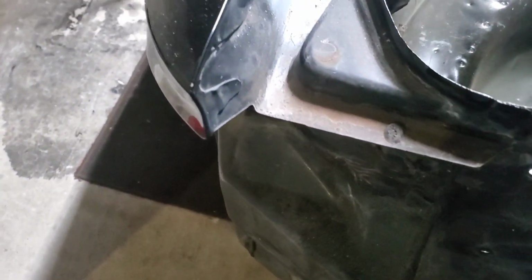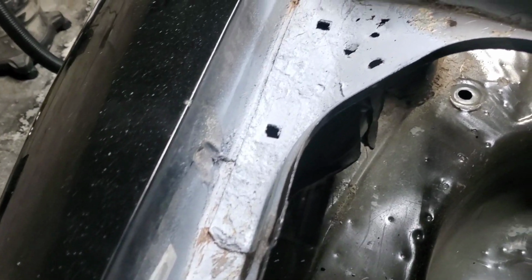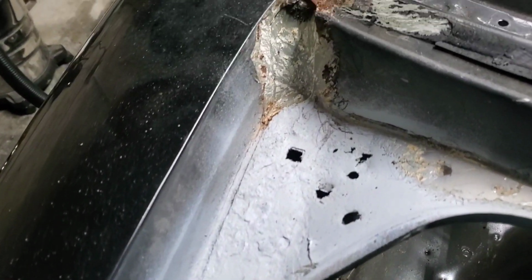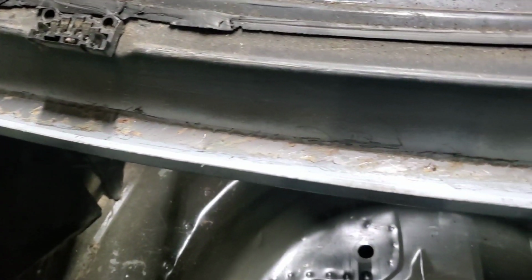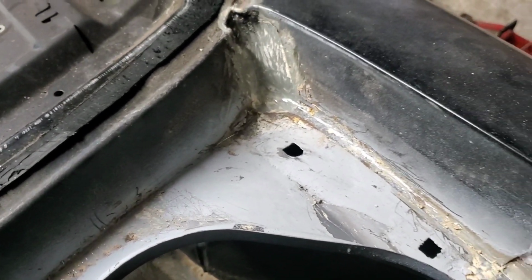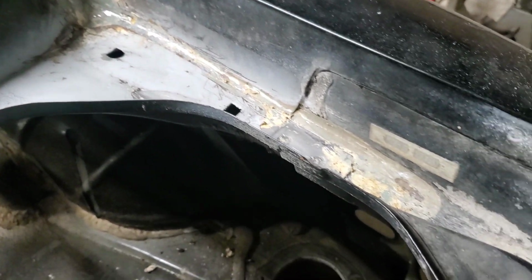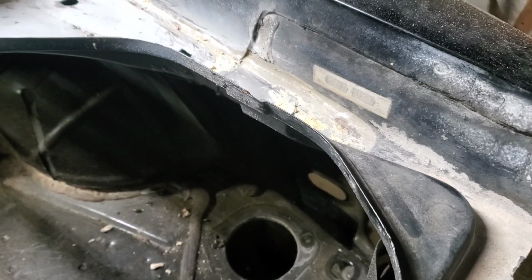So I made a little detour on my way to the passenger side rear floorboard, and I gotta say, I am ecstatic. I brought the heat gun back here, and all this seam sealer that I've been digging at and grinding on, the heat gun and scraper took it right off, no problem. I've been doing it wrong for years. Learn something new every day.